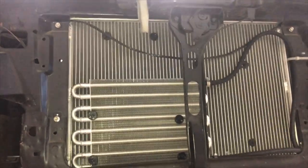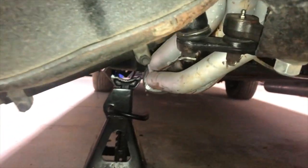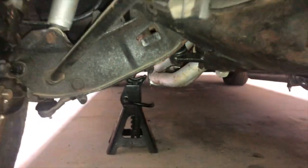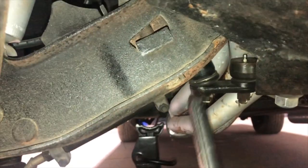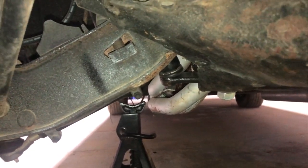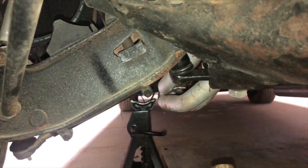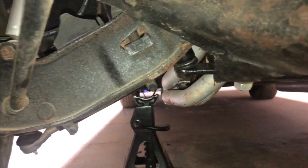So we're looking at the front of the vehicle. I'm going to start on the passenger side. All we're going to do is come up underneath here until you see this bolt — it's that simple. There's the front coming in; the bolt is right here. What you want to do is loosen this bolt to bring the front of the car down, or tighten it to bring it up. You want to do everything the same — however many turns you do to this side, you've got to do to the driver's side.